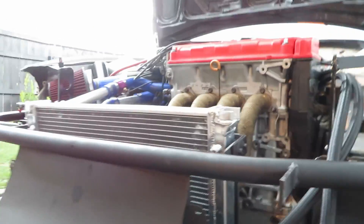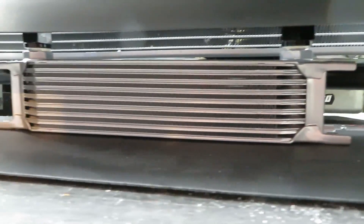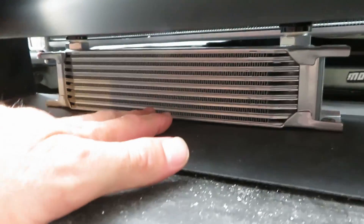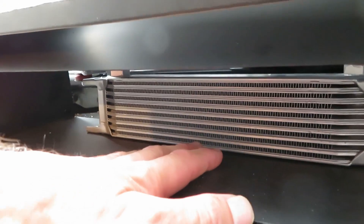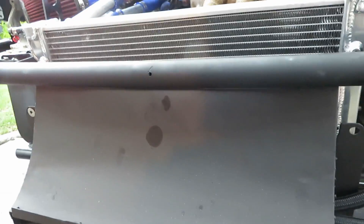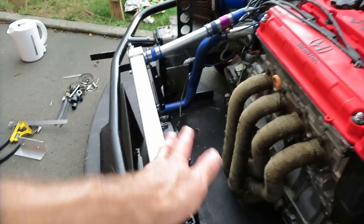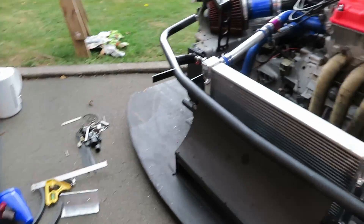The baffle goes at a lesser angle just to help airflow attachment and make sure the top of the radiator is getting the air it needs. There's an oil cooler in there now — it's the smallest oil cooler I've ever run and I'm a little bit concerned about it, but with this whole setup I'm remaining positive. There's also a duct which comes out of here into the hole in the bonnet.